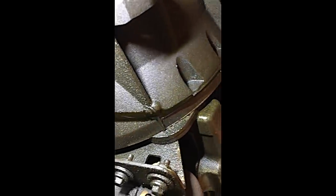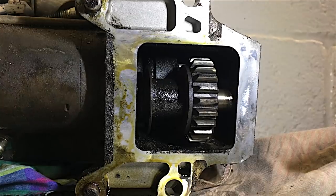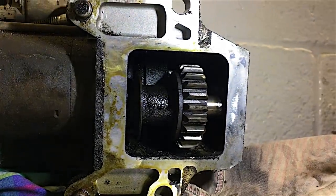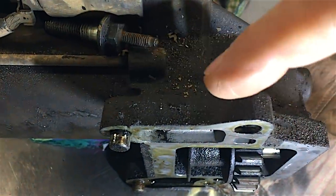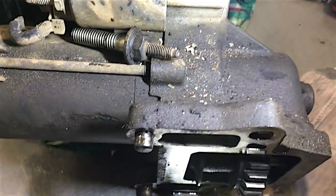This has got one hell of an oil leak somewhere — it's bloody pissing out. I'm going to pull the starter motor out now. The amount of oil that's come out — I reckon it's getting flung in there from behind the flywheel. I thought initially it was coming from the top, but on top of the starter motor there's only some residual oil. Every time I put this car up there's a puddle of oil underneath it from what we think is the rear main, but there's actually nothing on top of that starter motor.